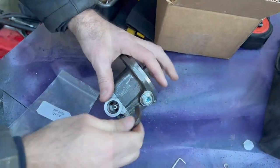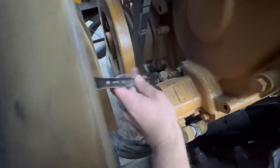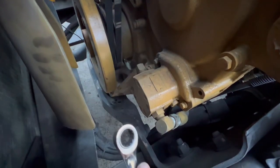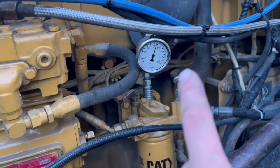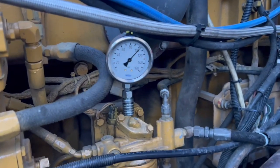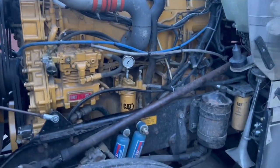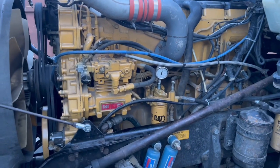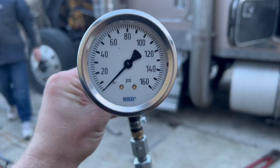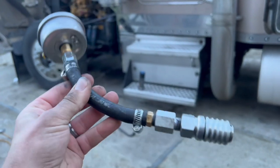On the pump itself this one is a 25mm and we got an 18mm for this one. This one is a little bit harder to get to and they are very tight. That's it — all it is is these two bolts — and it's gear-driven, there's no timing or anything you have to set, so you don't have to worry about that. Got the new transfer pump on — now we're pushing almost 90 PSI at idle. If you're gonna do the transfer pump upgrade and the spring upgrade, check your fuel pressure first. See if you're getting at least 90 PSI at idle and at least 100 PSI at 1500 RPM before doing the upgrade.